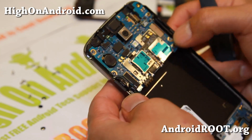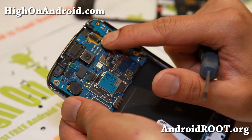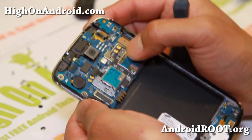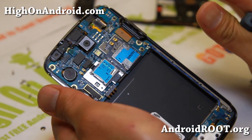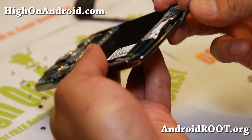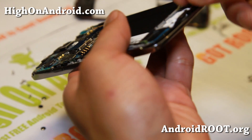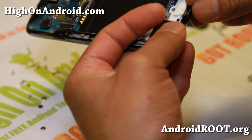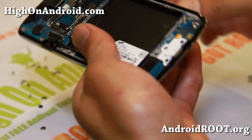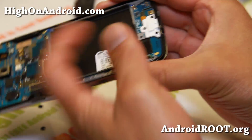All the hard part is over. Just double check everything is connected. Check the antenna, check the LCD, make sure it's on, check the LED flex cable that goes to all your LEDs, check the proximity sensor and the front camera, and also the USB connector — that's pretty much it. We're all done. Put the cover back on. Go ahead and plug in your USB cable here — just plug it in that way you don't have to worry about it. There should be a space for your tab there, so make sure it doesn't fall. I find it easier to put it on the motherboard side — make sure it's in correctly like that.